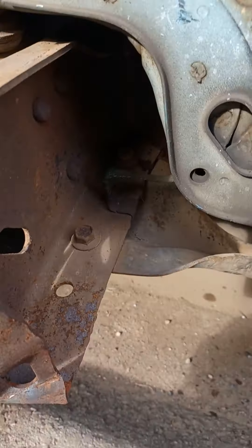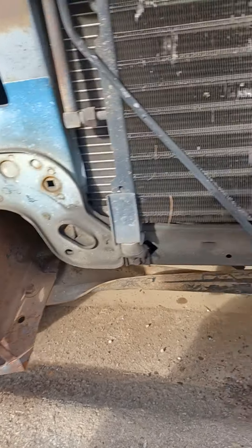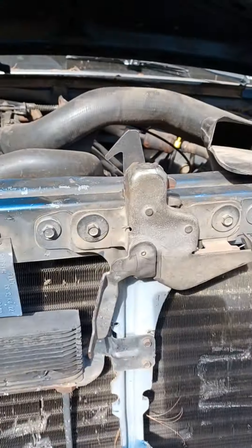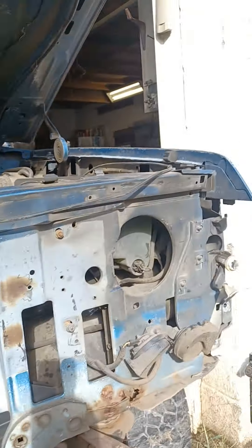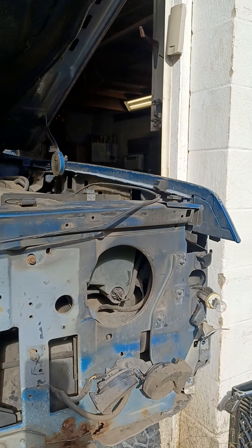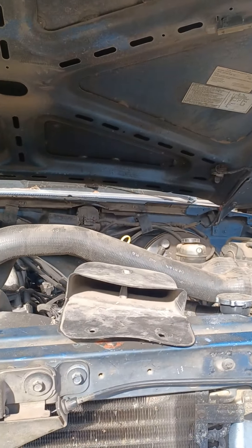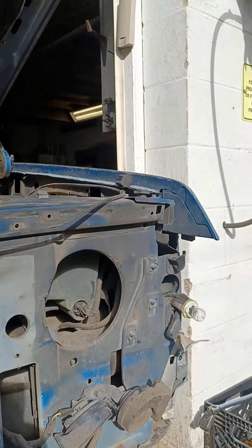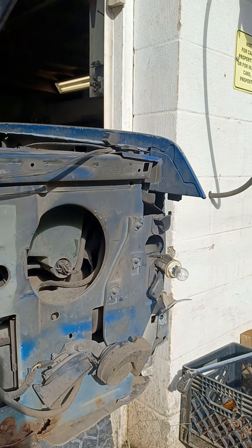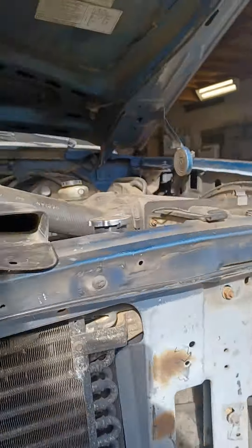We got this one — there's a big section in there where it's been twisted. That has to come off; this has to come out a little ways. I've got to stretch the fenders back out. What I'll do is loosen them up a little bit, keep the back by the doors tight, hook a clamp system here, and just give it an easy tug with the come-along to stretch the fenders back out.